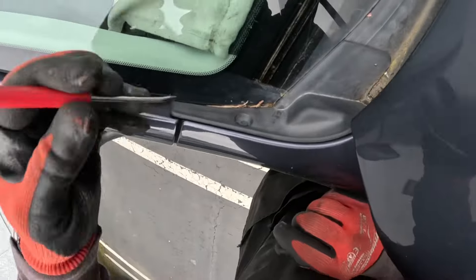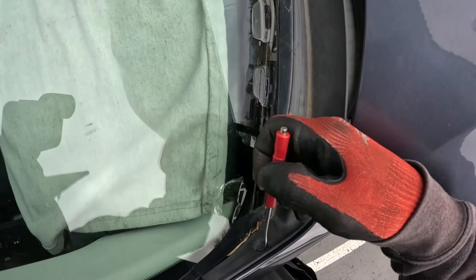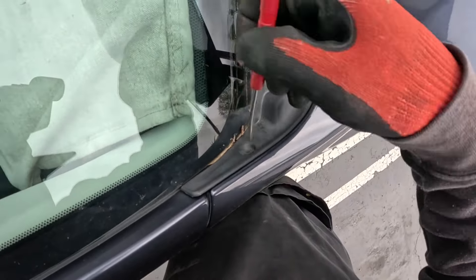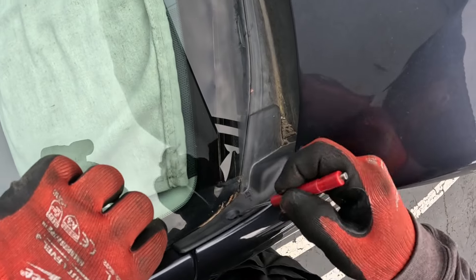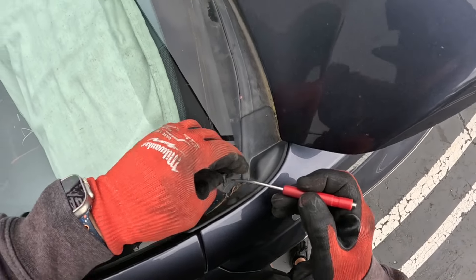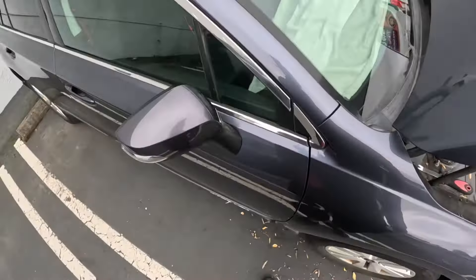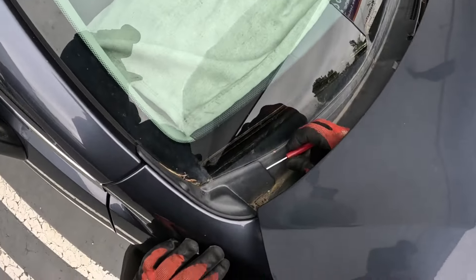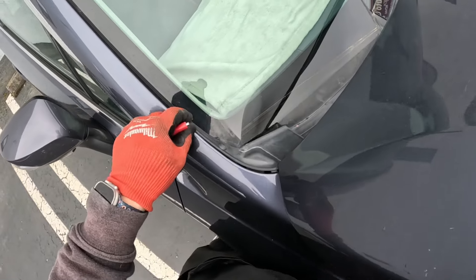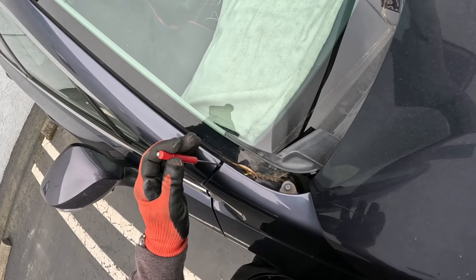See the little push pin in the middle — push that in. Rather than trying to dig in from the side, which risks breaking off those little flanges, go in right between the body and the trim piece. That helps move it out a little bit so you don't snap those fins off. They can be pretty brittle. Then you can take your screwdriver and lift underneath here. These ones with the really long fenders just bend up — tweak it up a little bit.